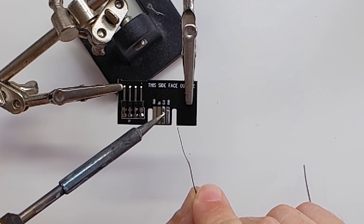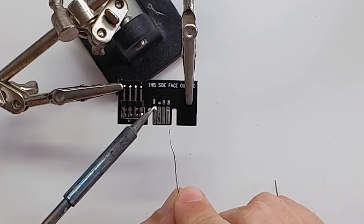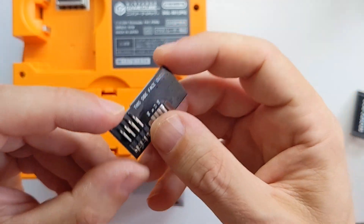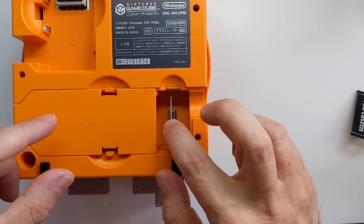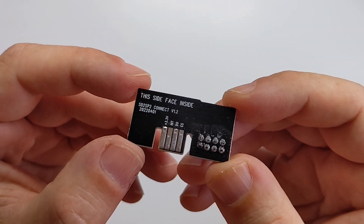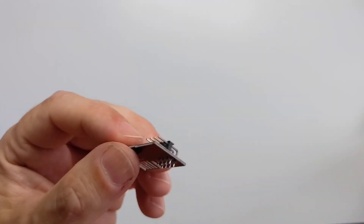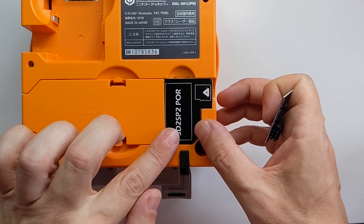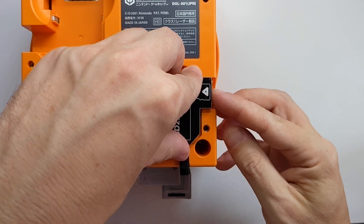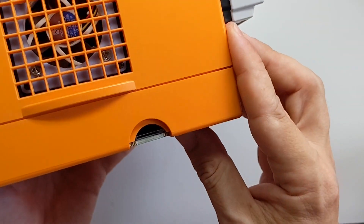Add some solder, smooth it all across the surface. You don't need much solder at all — if you put too much on it'll make it too difficult to fit into the slot afterwards. The flux will definitely help in terms of avoiding any bridging between contacts. Now I've got this little layer of solder on the surface. Fitting that into the slot feels much more secure with a lot less wobble. Do give it time to cool down before putting it into the console. Once cooled, plug it in. I've now got the neat fit with the other section which fits in just neatly without having to remove the serial port 1 cover. Assembling the two together and pushing into serial port 2 — it fits securely, held really neatly in place.